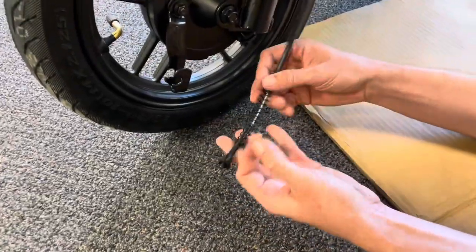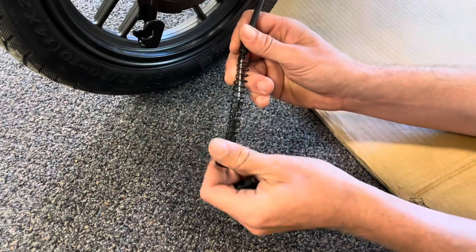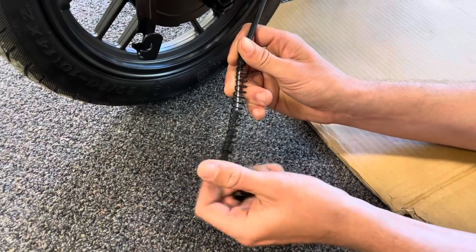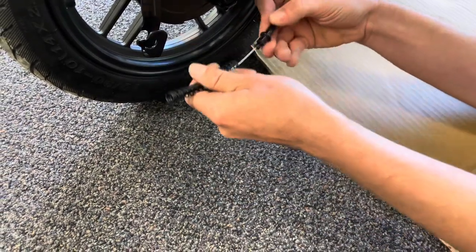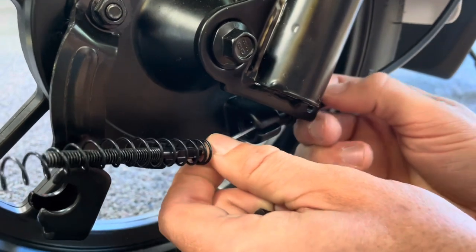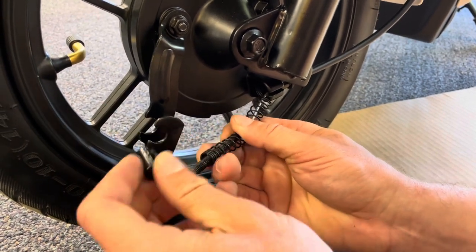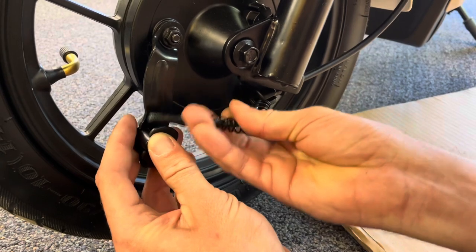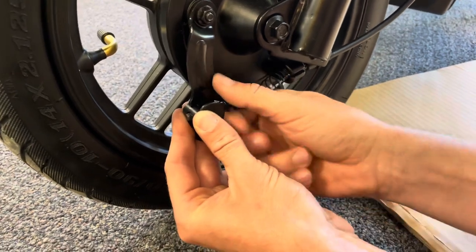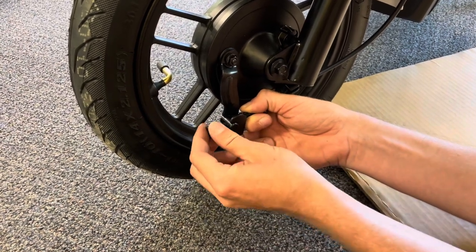On a lot of new bikes the brake will come unassembled like this. To set it up, unscrew it — it's usually on there. Get the spring forward to the securing point and get the cord through the little groove so it slides into place. Push this back, put it into the two grooves, and get it through that hole — it takes a little work. Pull the spring back, create some space with your finger to attach the fixing bolt, then tighten it to your desired brake stiffness.